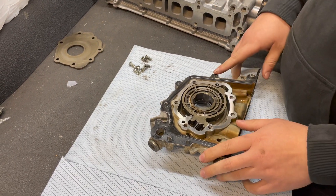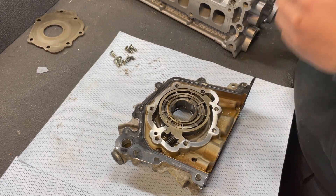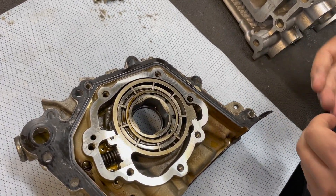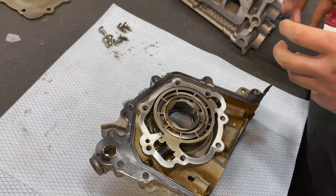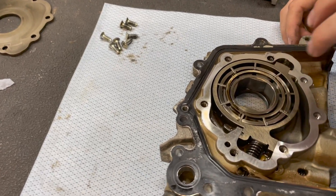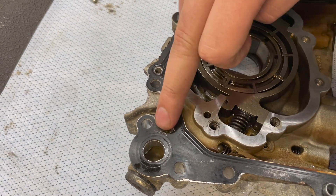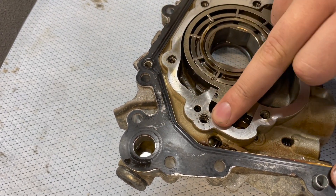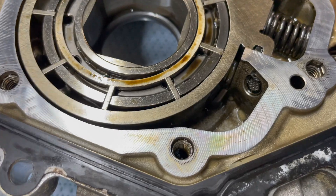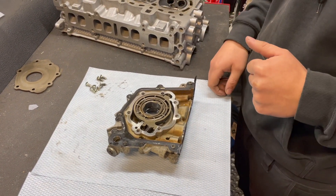The final thing we're going to chat about is the oil pump. These are a mechanical variable displacement oil pump. As RPM builds and oil pressure would normally build, this varies its output - so it's not just spinning and building oil pressure and dumping it through a relief valve. It will vary its output so there's less wastage and less parasitic drain. The bearings also get unfiltered oil - there are two outputs for the oil pump: one goes to your oil filter and then the rest of your engine, and the other goes to your crank bearings. The only filter for your crank bearings is a small gauze. So if you're skipping services, your oil is going to get full of contaminants and the first thing to go will probably be your bearings, which we suspect is what happened on this engine.